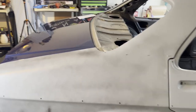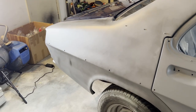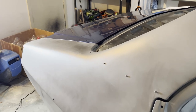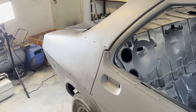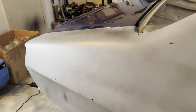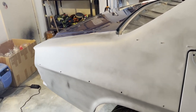Overall condition of the car does look pretty good. Now I want to talk a little bit about preparation of your primer. I don't know if you can see those scratches, but holy moly, look at that. What you're looking at there guys is basically really coarse scratches underneath the primer and it's not ideal — it does take a lot of effort to fix. You've got to sand all the primer off back to the resto finish, finish in 240, reprime it and then block it all down again.